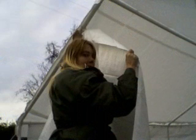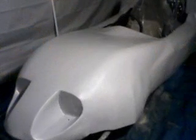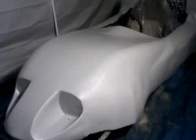Cut the plastic and fit the fans so that one fan is drawing air into the paint booth and the other fan is an exhaust fan. Tape an air conditioner filter to the appropriate side of each fan. Certainly this is not as perfect a solution as a professional paint booth, however, it is simple and cost effective, and it's much better than the alternative of painting in the open air.